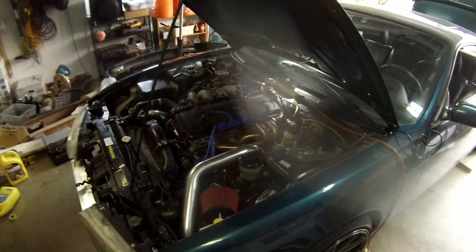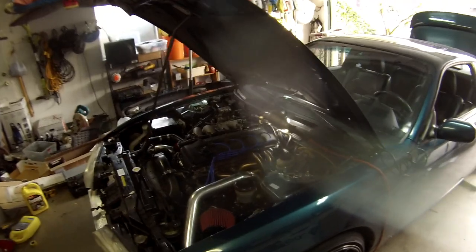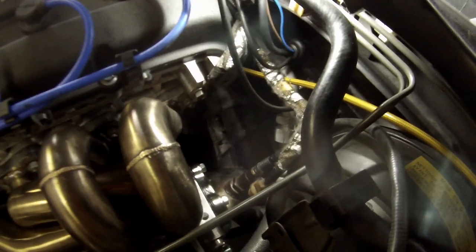The car seems to be running pretty decent. It started, so that's step number one. But it seemed to be wanting to stall out when I was revving it a bit. I just swapped out the narrowband and put in my wideband O2 sensor — it's way too close to the turbo which is why I'm not keeping it there permanently — but it smells like it's running really rich, so I want to have it plugged in to see what it reads.